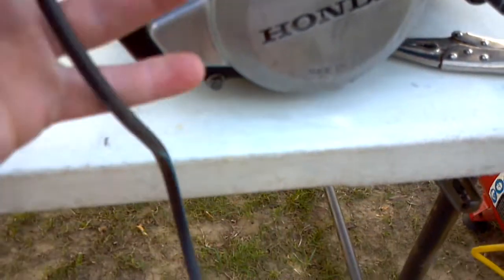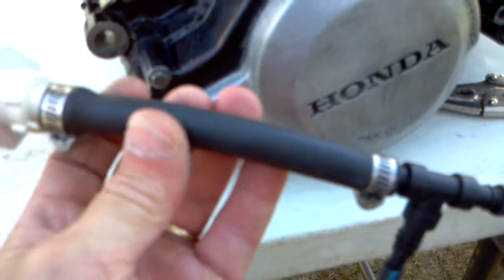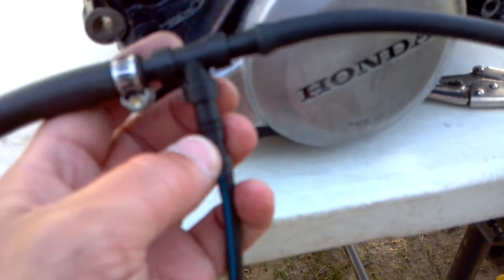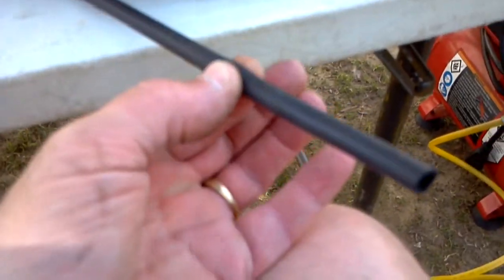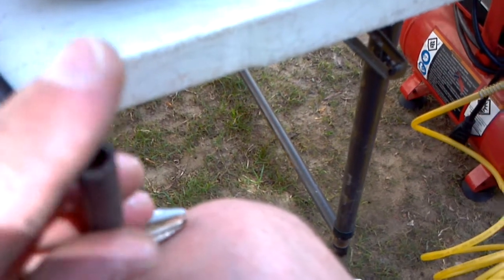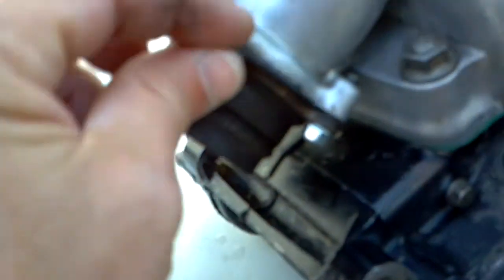You can just put the hose onto it. I used windshield washer hose running from the boost gauge to this T-fitting, and regular PCV tubing or fuel line onto the other end. When you get the T-fitting, get a pack that comes with a variety of different sizes so you can match all your lines up. They make little clamps, but I just fill it up to 7 psi and clamp it off with needle nose pliers. Then I take a little soapy water and rub it over the tube just to make sure it's not leaking.